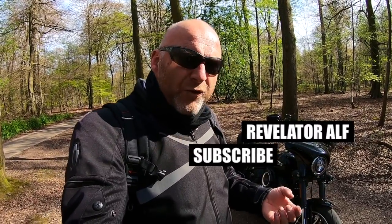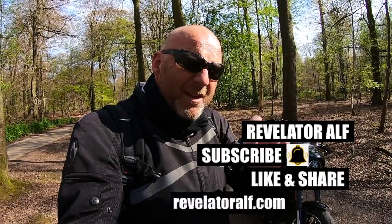But most jobs can be performed on the bike. Even a gearbox on Harley-Davidsons is designed for you to be able to do it in the frame. Do it in the frame and it's a lot easier just to put everything back in. Service manuals from Harley-Davidson I know will say you can leave this in the frame. Other motorcycles I've worked on — where I've got the workshop manuals — they actually say this can be undertaken with the engine still in the chassis or still in the frame.